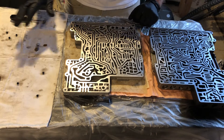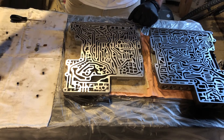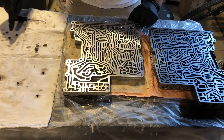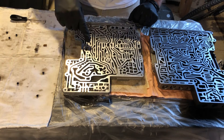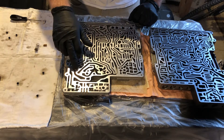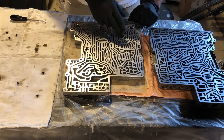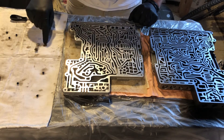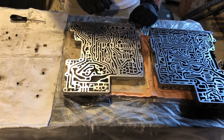Those look pretty good. Now we have to go through this side. Starting from the top corner, we have one, two, three, four, five, six, seven, eight, nine check balls, so we'll start here and work our way around. I believe we'll end up with a ninth one here. We have a spring going here, a spring going here, a large screen right there, and this smaller one goes right there. Let's go ahead and get those pieces put back in.